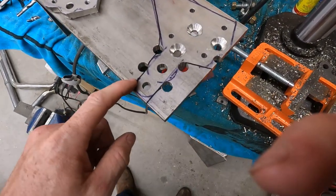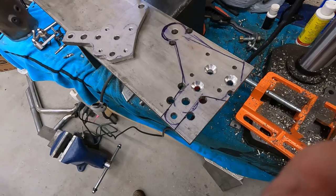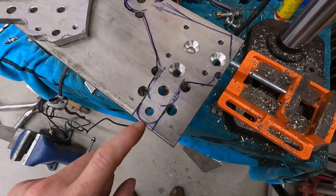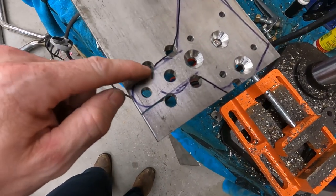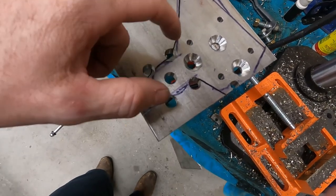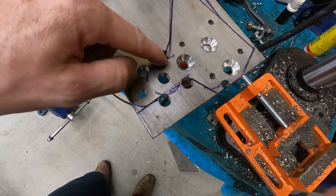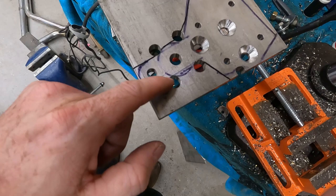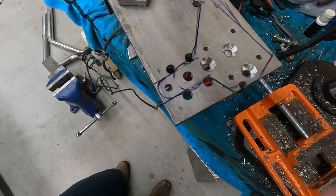Last night I had started cutting out the plate. I got about halfway and then my blade snapped. The blade is pretty old. This stainless is pretty hard on it, but as you see here, I have a bunch of holes drilled in this plate. These are for the inner radiuses on this. You can see where I cut it here, and then I have this inner radius, and then I cut it through. So it makes it a lot easier for me to cut it out because these are 1/2 inch holes. My blade is 1/2 inch, so I can rotate in here. Also, it gives me a lot nicer and cleaner radius here, and I don't have to do as much grinding and cleanup later. So you can see I got some of them cut. I still got to cut this here, and then this back side, and then this piece will be free, and then we can start our cleanup.